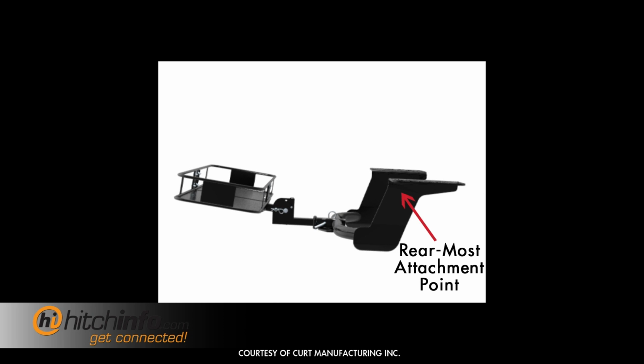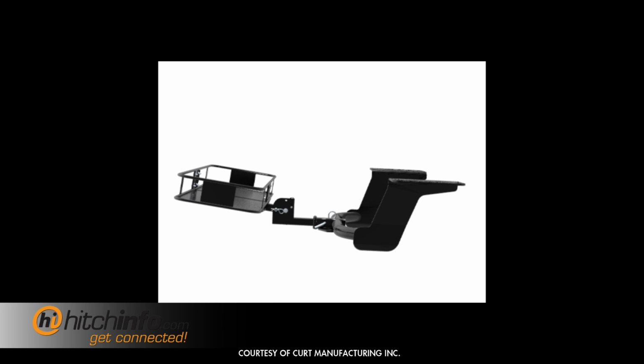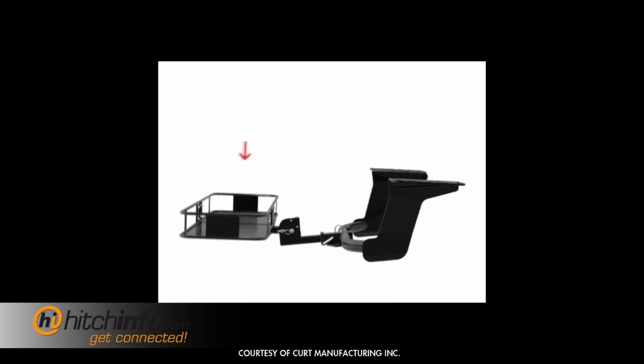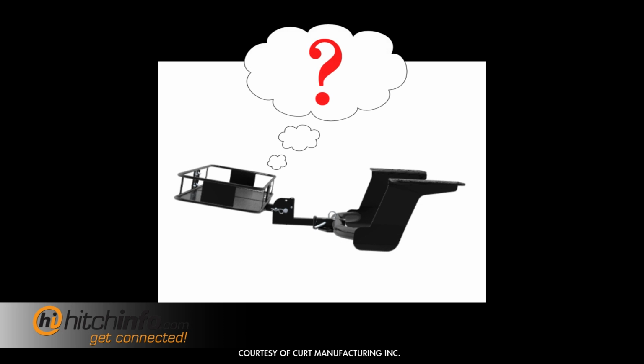All hitches have a tongue weight rating. This is the maximum amount of unsupported weight that the hitch can handle. Tongue weight capacity is rated at the edge of the receiver tube here. So the further the load is away from the edge of the receiver tube, the greater the force at the pivot point. So you may be wondering how you figure out how much weight you can place on your carrier.